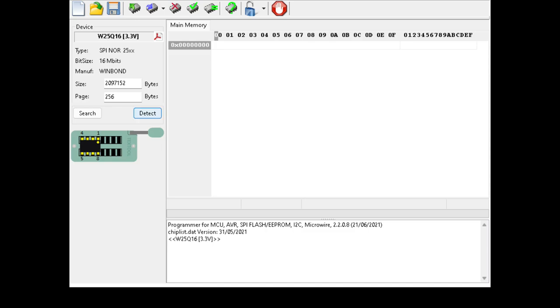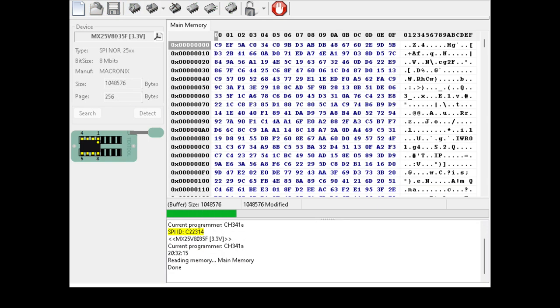Okay. I'm going to put some juice onto this, otherwise I ain't going to see it, is it? So we want 2.5 volt, 0.186 milliamps. That's not very high. Let's see if it'll just find the chip, detect. Yeah, there you go, look at that. That's pretty good, isn't it? Select. So that's selected. Let's try read. Read IC. Looks pretty damn good to me.